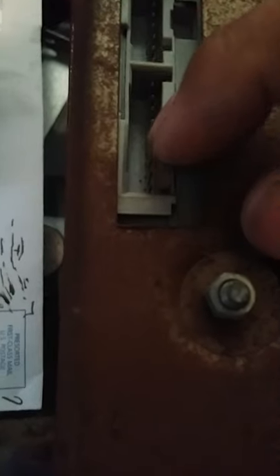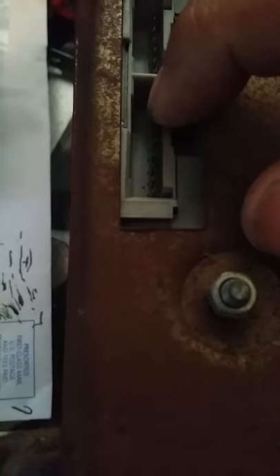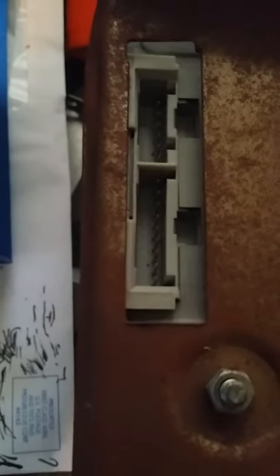I have written down here: pin 16, which is the far pin, is 14 volts. Pin 13 is tape auxiliary slave on. If you want to tap audio into here you can use pins 11, 10, and 9 — pin 11 is audio common, pin 10 is right audio channel, and pin 9 is left audio channel. That's coming off the tape deck. There's also some data communication in there in case you're using an equalizer deck. Pin 16 is the far one, pin 1 is the first one up there — you just count them.